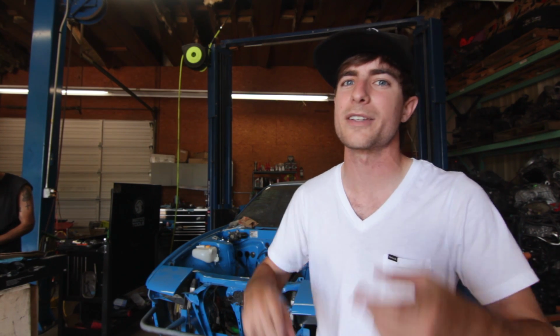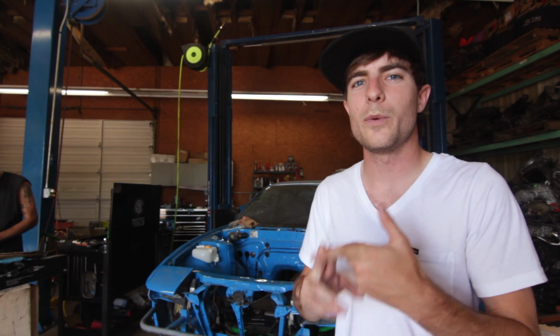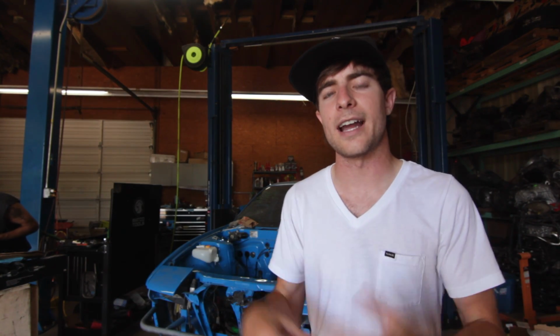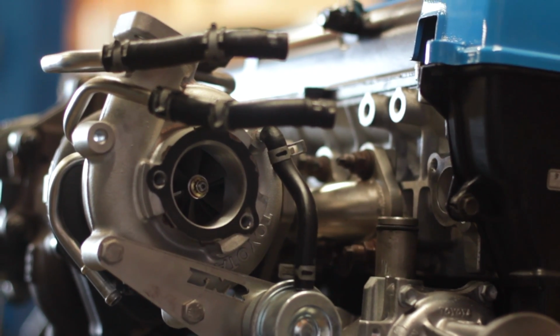Also, a lot of people thought I was going to go big single turbo. I had no intentions on going big single turbo because one, I wanted to be different because I'm weird, and two, I really wanted something that had a more linear power band in such a light car. I had no intentions on doing crazy high speeds or anything like that. I just wanted something that felt good around corners and mountain roads and things of that nature, so I did a built GT28 setup instead.